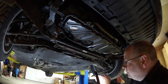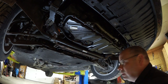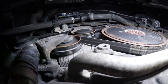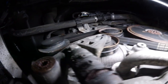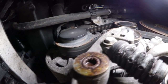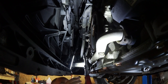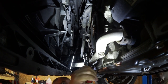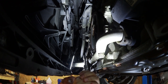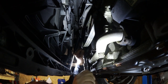I had taken all the belly pans off early this year before I had it sprayed. It's just too covered up to bother spraying without doing that because they won't be able to reach anything. That's where the belt goes. Three-eighths drive ratchet — I'm going to pull down on this to slowly compress the tensioner a bit, which should be enough to get the belt off the tensioner pulley.